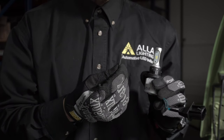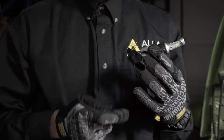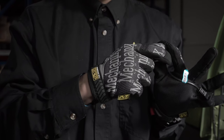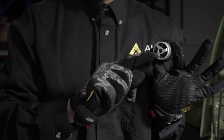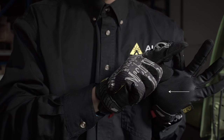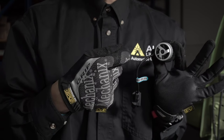Remove the screw. Grip the securing bracket and twist the bulb. With this style of LED bulb, it has what we call a pigtail. So if you notice where the pigtail is coming out of the bulb, simply twist it. We moved ours from 3 o'clock to 9 o'clock — 180 degrees. Now that the beam angle is adjusted, let's reinstall the bulb.